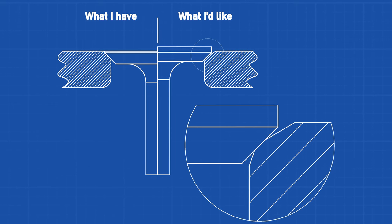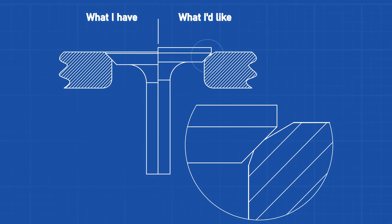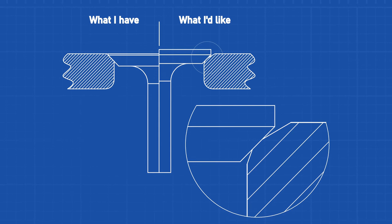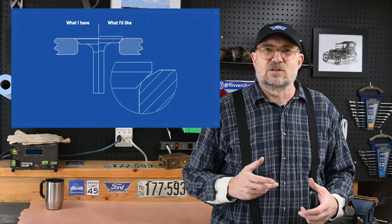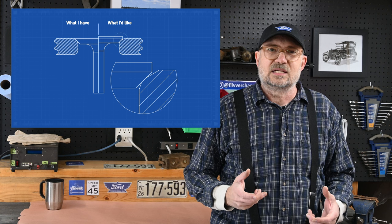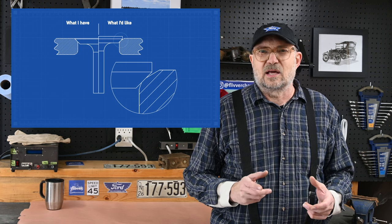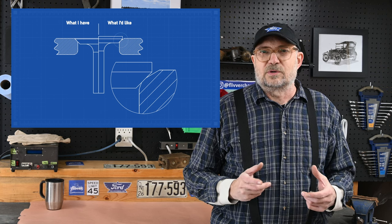In any case, since round seat cutting tools are not common, and since thousands of valve jobs have been successfully completed with modern angle seat cutters, I decided to attempt conventional three-angle seats. Since my old valves were worn in very deep, I was going to need to remove quite a bit of material to completely reshape the valve seats. As an homage to the radiused seats, I decided to make the landing of the three-angle seat very narrow, thereby approximating the line contact that a radiused seat would have produced.